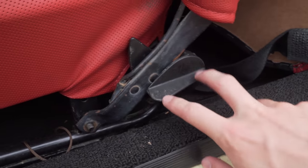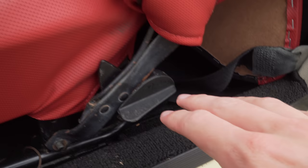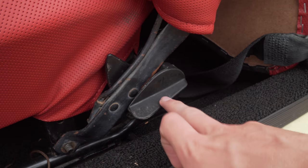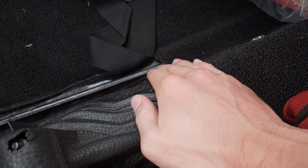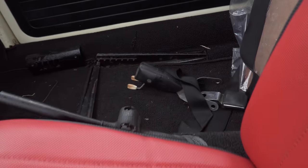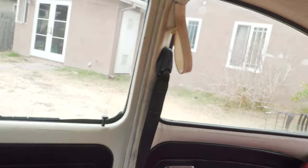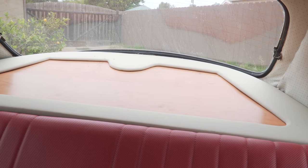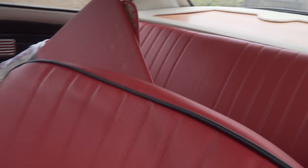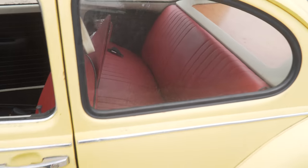I do have the passenger seat, but it's not in the car right now because it wouldn't fit. When it was getting reupholstered, the little lever — essentially just a cam you twist to adjust where the seat sits — got put on the same side as the driver's seat, on the left side. When you try to put the passenger seat in, that interferes with the trans tunnel. The seat's in the garage and I already swapped the adjuster over to the right side, so I just need to put it back in. The seat belt just needs to get bolted back on, and we've got a little cover in the back that's pretty clean. Really clean interior overall — I'm super happy about it.